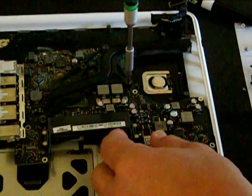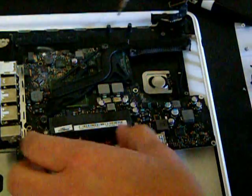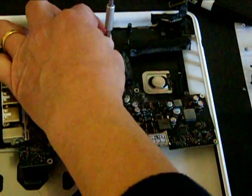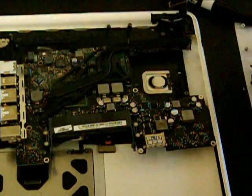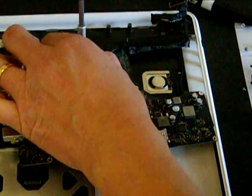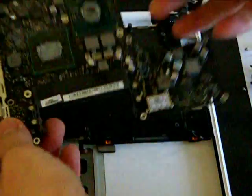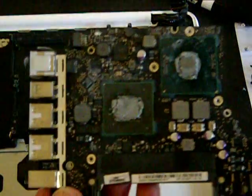One of the reasons why the machine or the laptop is slow or overheats is that the thermal paste in between the CPU and the heat sink is no longer effective. The ability to transfer heat from the CPU to the sink is compromised — that is why you always experience overheating, especially when you touch your laptop and it sometimes feels more than the normal heat.